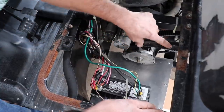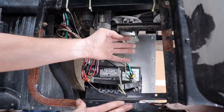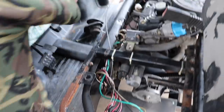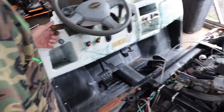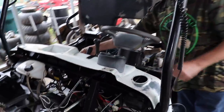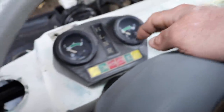I think maybe the battery box was supposed to go here and the battery dropped in — maybe it was plastic and it broke. But just about everything works now. The horn works, the turn signals work. The gas gauge doesn't work — I think I need a sender, which they've got at VMC. The temperature gauge didn't work either.